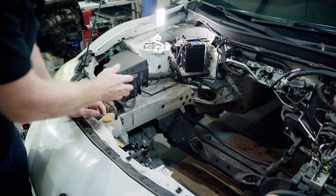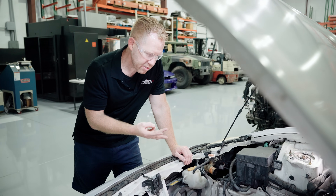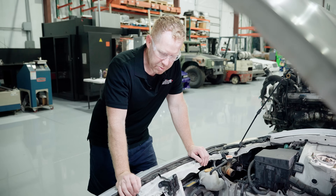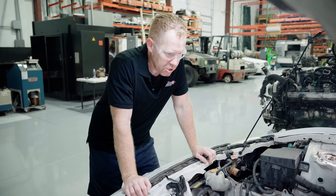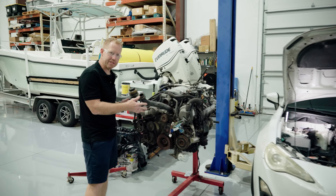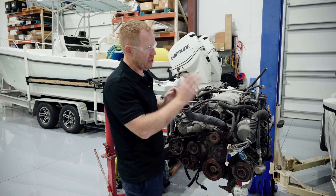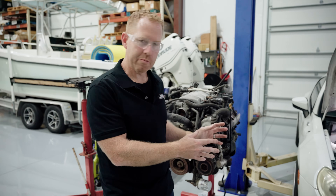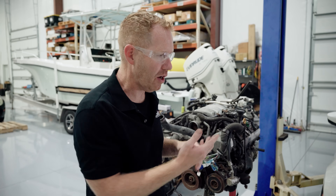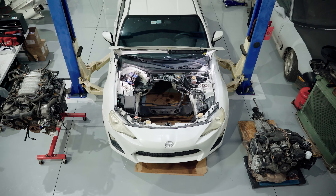This is a large engine bay, front-sump capable, and the prime candidate for an engine swap — whether it's 3UZ, LS, K-series, or even a JZ. We're going to use the 3UZ with the stock six-speed FRS transmission; the other options would require something like a 350Z transmission to handle the power. Next video we'll go through how to install the transmission. We need to prep the motor minimally, and prep the chassis — mostly the transmission tunnel and crossmember area — removing a few OEM pieces of sheet metal to set our new transmission tunnel reinforcement bracket system, and then drill and install that to get the 3UZ from an SC430 into the FRS.